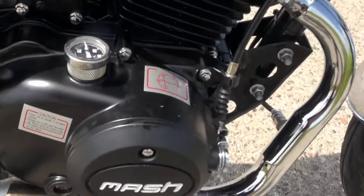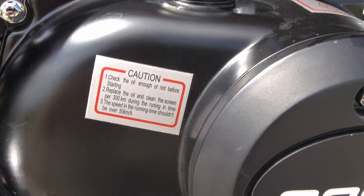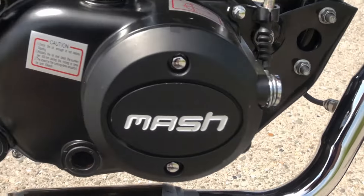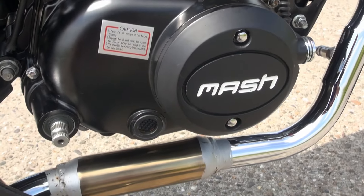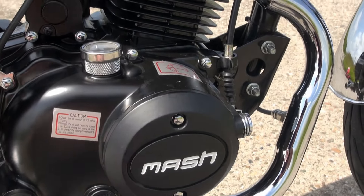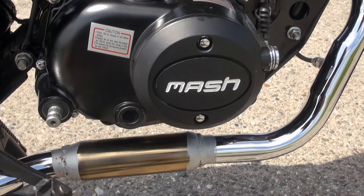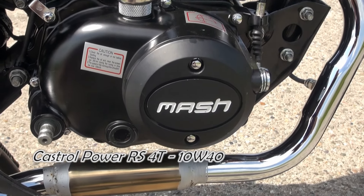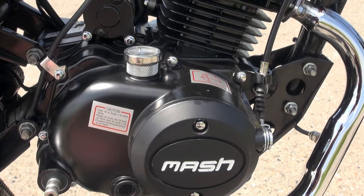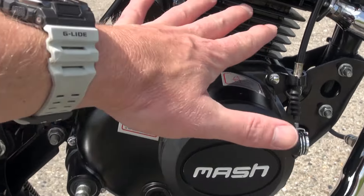There's a sticker here with some advice on the run-in period and it says to replace the oil and clean the oil filter screen, which lives just below the pickup of the oil pump — and that's what I did. I did it after 200 kilometers because the break-in oil is really thin, so I took the clutch cover off, drained the oil, checked everything. There was some debris in the oil screen and now I have new oil in there. The important thing is that the oil is JASO-MA compliant, meaning the oil is suitable for wet clutches and gearboxes that share the same oil as the engine.